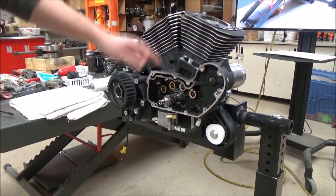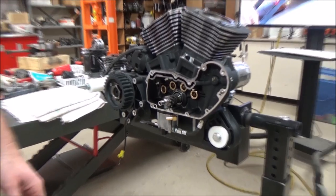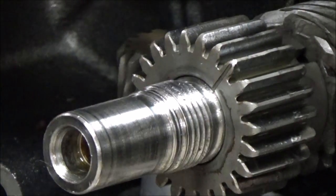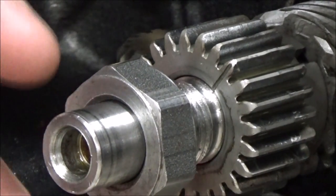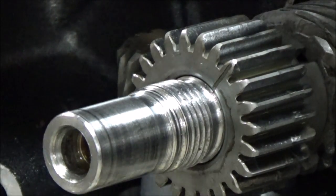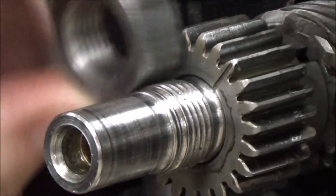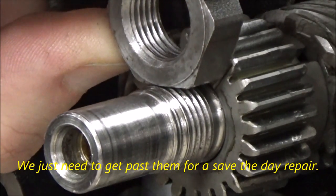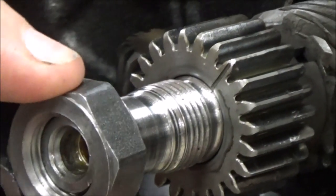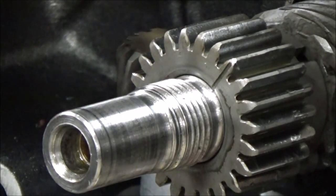What I've got here is a Harley-Davidson V-Twin engine — technically this is a whole crankshaft replacement, it's bad. Let's look at the damage first. Somehow these threads got damaged, and you'll see that I cannot start a brand new nut — it's just caught right there. The threads on the backside are fine; it's just the first couple that are messed up. Those first couple threads I don't even need — when this gets torqued into place, all the good threads are on the backside. We just need to get past those damaged ones to fully torque the nut against that gear.